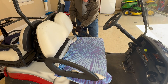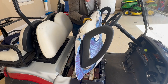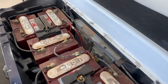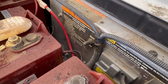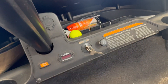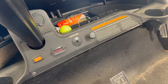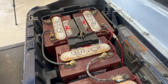In order to get out the batteries, we just lift up the seat — it's on a couple of hinges and it comes right off. Now one of the first things we want to do is there's a run and tow switch. Right now it's on run, so I'm going to move it to tow. Then we're going to pull the key out of the switch so no juice will flow to this compartment as we're working on it.